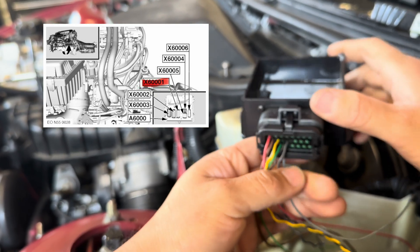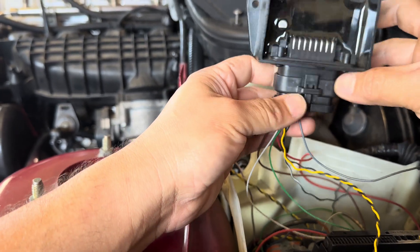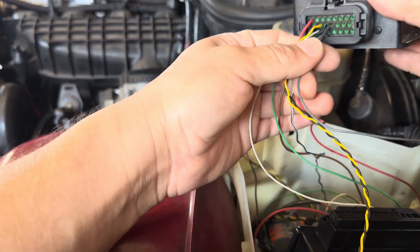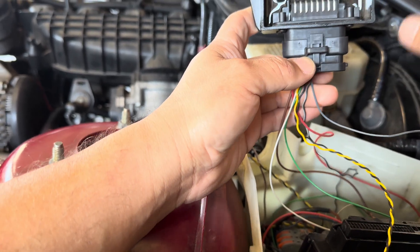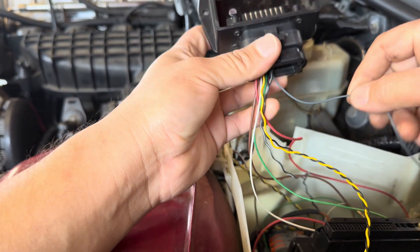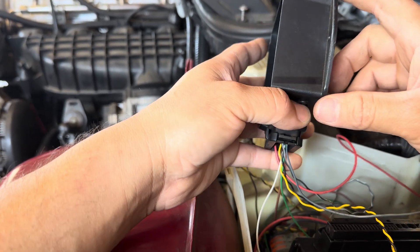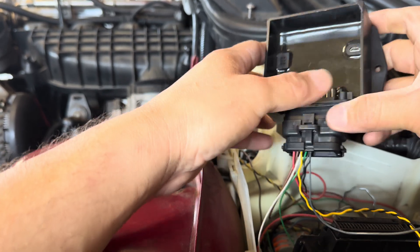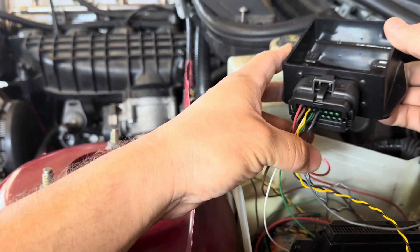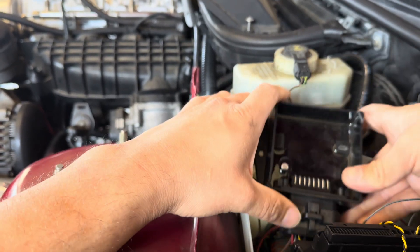This module lets you use your E46 cluster. It also works for an RB swap since it's made for an RB. I'll go ahead and put in the pin-out for the E46 plug connections and pins, same with the E90 DME to get the RPM signal, so you can wire one of these into your swap. I know there isn't any real video on how to wire one of these things in, so I thought it would be nice to show you guys how simple it can be. Let me go ahead and turn it on for you guys.